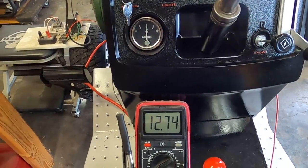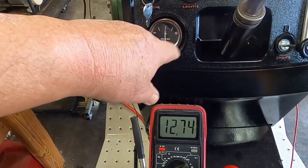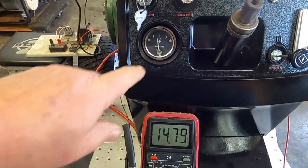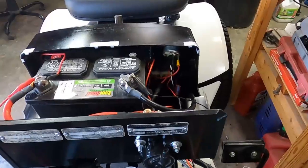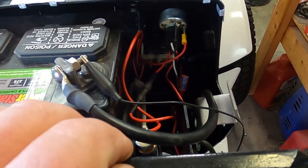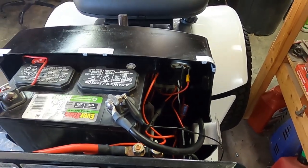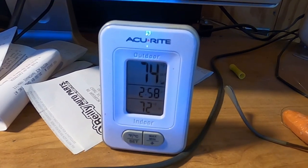I've got them both in the picture — the amp meter and the volt meter. I don't think they make dual meters round, but I could be wrong. We're gonna see if it works. I've got that hooked up backwards. Unfortunately I'm going to have to pull the battery out so I can swap the leads. I could have sworn I had that hooked up right. Let me yank the battery back out.